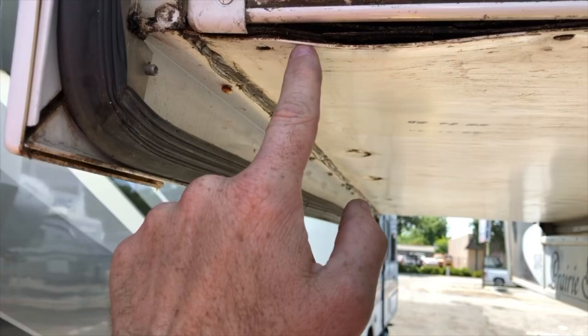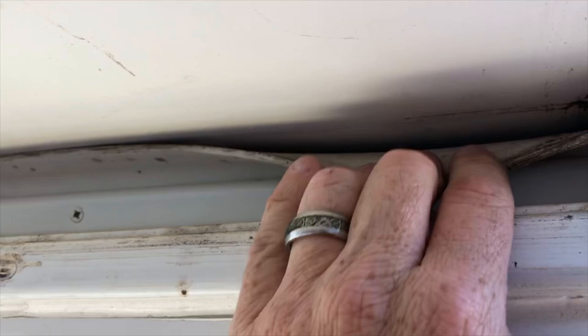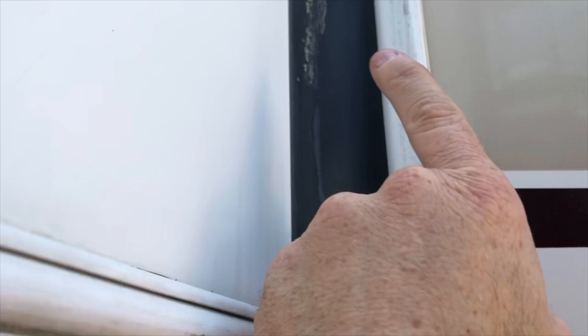You can silicone these side edges. This insert molding shrinks up and becomes hard and cracks — it needs to get replaced at least every three to five years. Periodically come underneath the slide out and make sure you don't have any screws that are rusted or backing out. Trim off any putty tape that's bled out, as it will get on the wiper seals and cause damage, scraping, and scratching on the floor and siding of the coach.